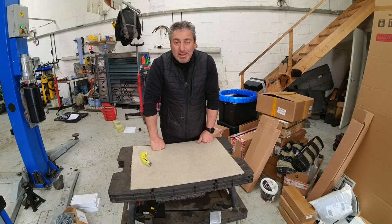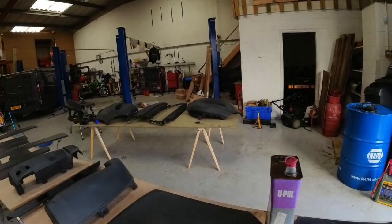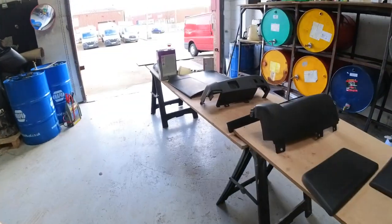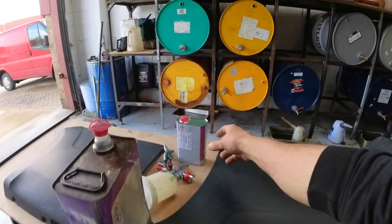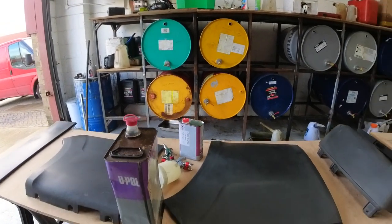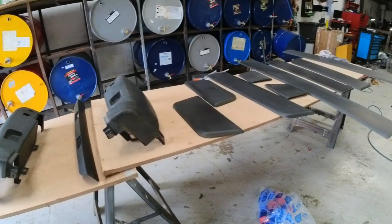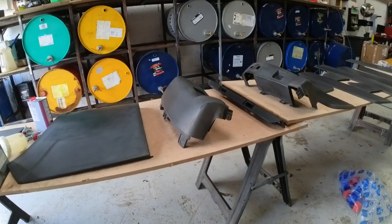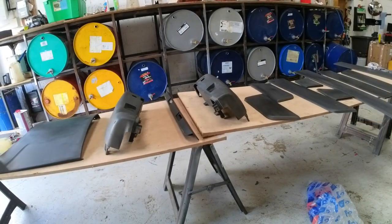Harley's almost finished with the plastics so I'm going to get those all cleaned up, plastic prime them and then paint them. There are a lot of plastics on this van - up here, the bumper corners, bits over here and the rear bumper. We're using U-Pol plastic primer - put it in the gun and use it, no need to thin it down. I'm just using my cheap priming gun. These plastics are so dirty we've had the panel wipe on twice - mud really stains plastic but doesn't matter if we clean it, none of it's coming off. It's supposed to be part of the plastic. The bumper corners are a little bit scruffy but I'm not too fussed - I just want to paint it and get the van back together.